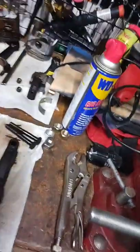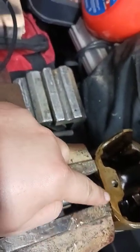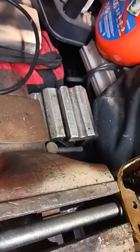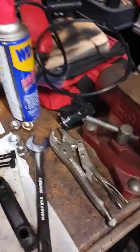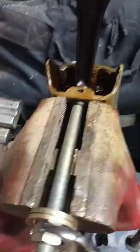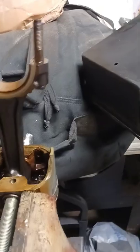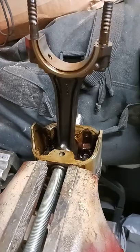You'll just have to have faith that I'm giving it a turn or two or three. Now it's snugged in there. You want to keep it as straight as possible — make sure there's a little gap on either side of the wrist pin so it's not dragging along the vise teeth, otherwise that will make this considerably more difficult. As we start pulling, you'll hear a pop — that's the pin unseating. Just listen for the pop. There you go; the rest should just be a straightforward pull.